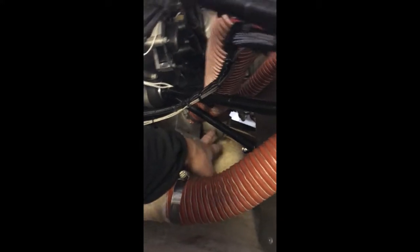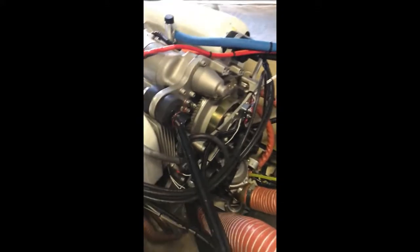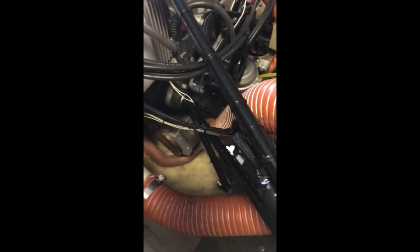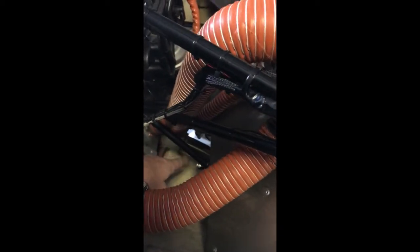You've got to be very careful with your cabin heat exchanger down here, because it hits the bellcrank of your nose wheel steering with full left or full right nose wheel steering deflection — which just happens to be the way I would do a U-turn on the runway during my line-ups. You get a bit of knock, knock, knock. It's only at full deflection. I've moved the heat exchanger up as far as I could, but now it actually hits onto the exhaust pipe itself. I'm not going to go full deflection in flight — it's only during taxi.